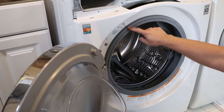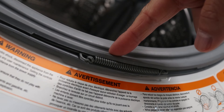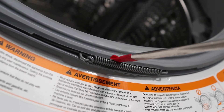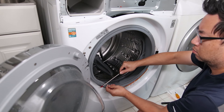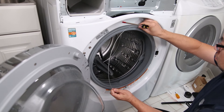Open the glass door and take out the retaining ring that goes around the big rubber seal. At the bottom there's a spring holding the tension of the ring. To remove it, carefully wedge a screwdriver under the spring and start pulling the ring out of the rubber seal. It won't take much to get this off, but it's extremely difficult to get back on, which I'll explain later.